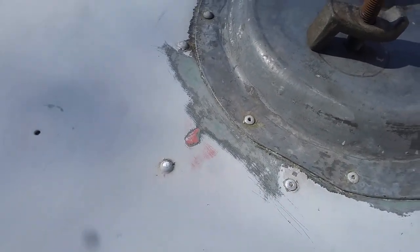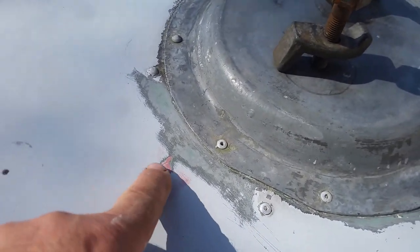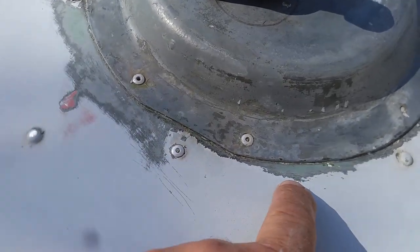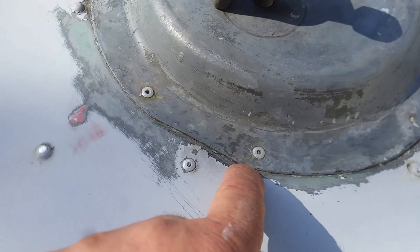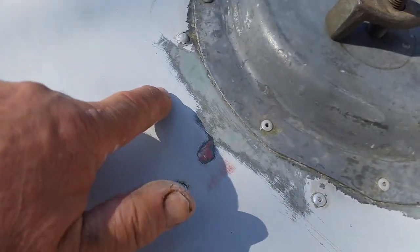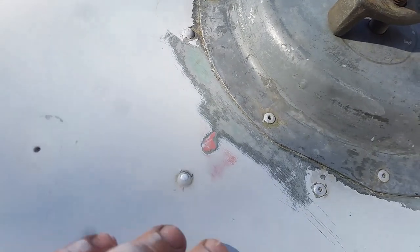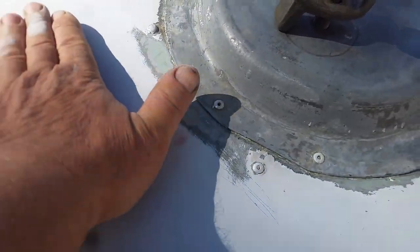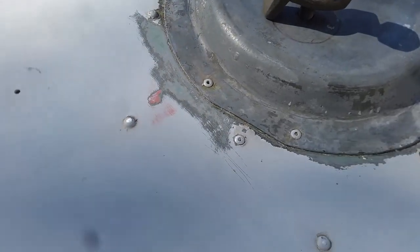You can see what I've got here — we've got a high spot which will have to have some panel beating attention. You can also see how I've got rid of the harsh sharp edges of the flaked paint and feathered them in, so that can be primed over and we'll have the appearance of just a smooth, continuous first coat of paint all the way up to the edge.